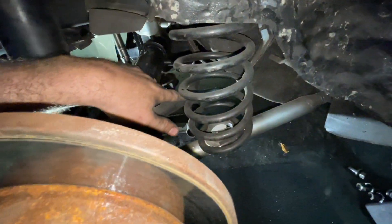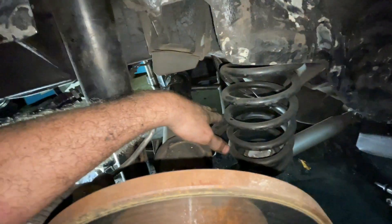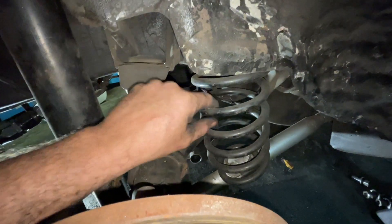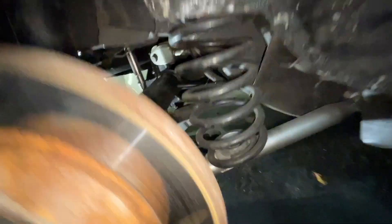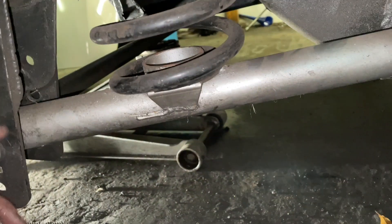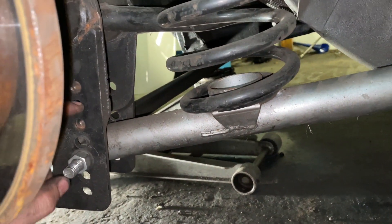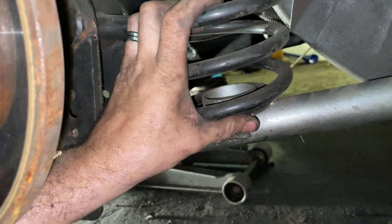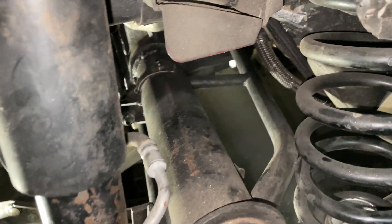This rear has been braced - Teddy Hauser did the brace and Nigel welded the lower control arm brackets. But this rear wasn't really set up for stock springs in the stock location; it was set up for coilovers in the back with a bar across the coilover. So what I had to do is come in here, cut that, and move it forward - which was awesome. That's the stock hole there, and with this being a stock length spring, nothing's been trimmed, just a stock GT spring. I cut it right here and moved it forward so it didn't bind.